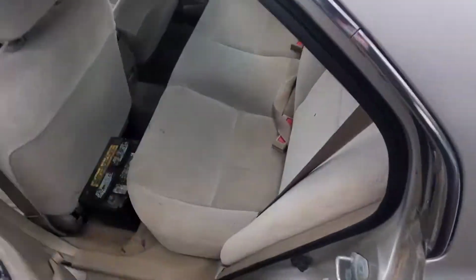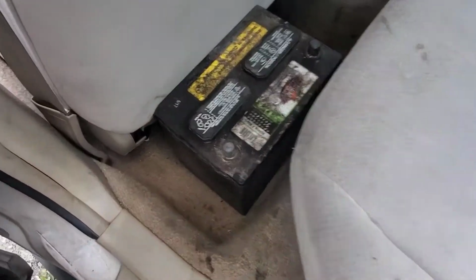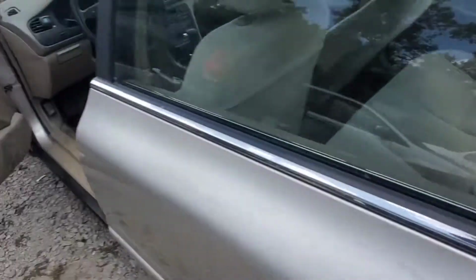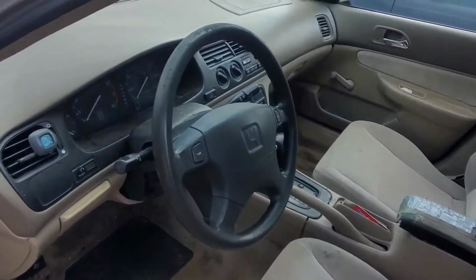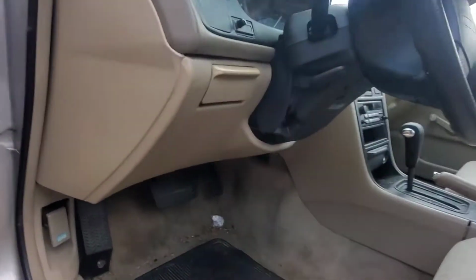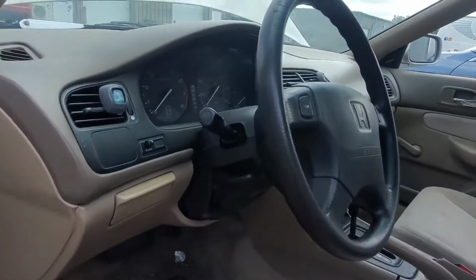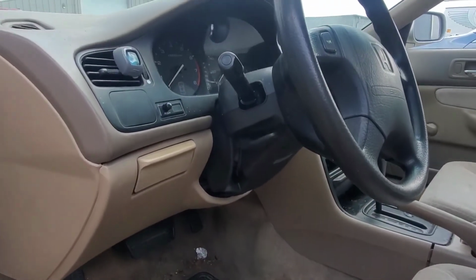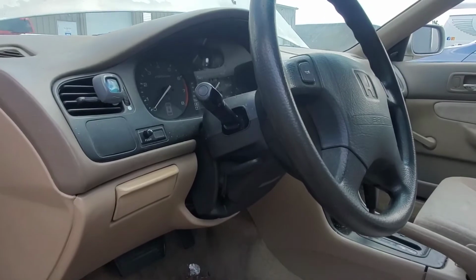Here's the old battery. It was 4 years old anyway, so probably bad anyhow. But yes, original problem was that pedal pad. Then they added the battery, then the jump start cooked the fuse. That is a good lesson to make sure to do your checks before tossing parts on.